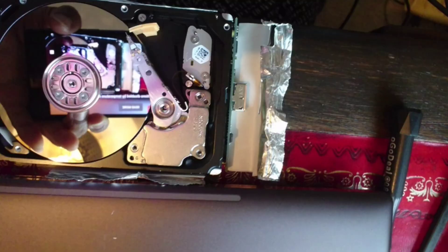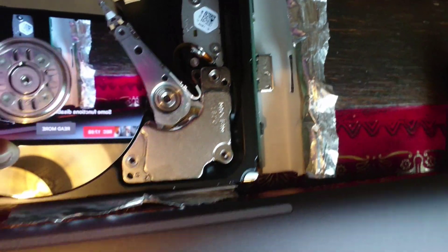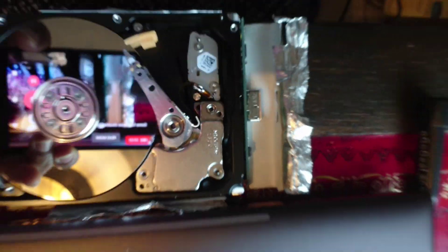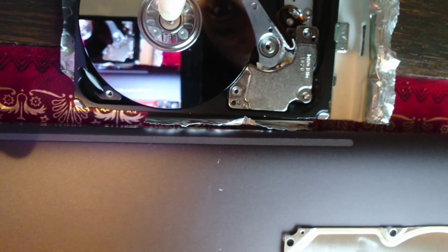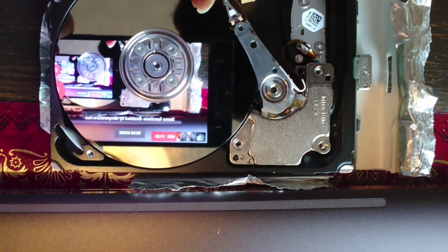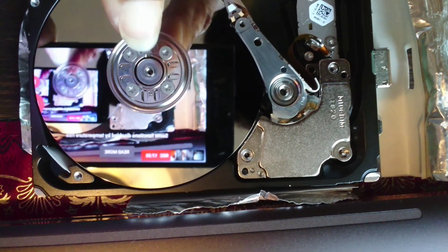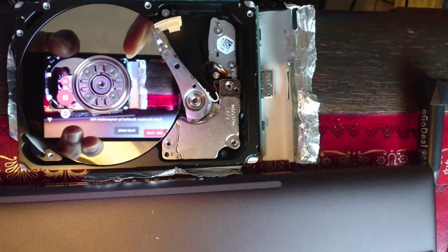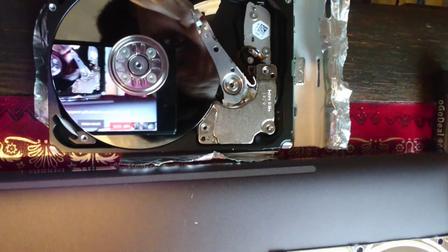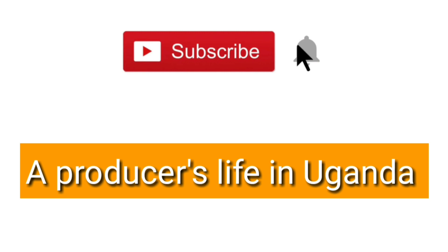Just to show you — this is where my read-write head was stuck initially. I'm looking away while I'm talking so that no saliva or spit goes on it. I need to find a way to move this back to the starting position — usually by twisting the middle. There's usually the shape of a screw in there to help you twist, but it's not there, so I could put another screw back and then twist it. I managed to get it back to the starting position.